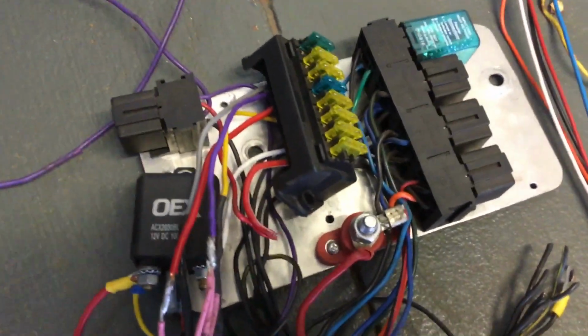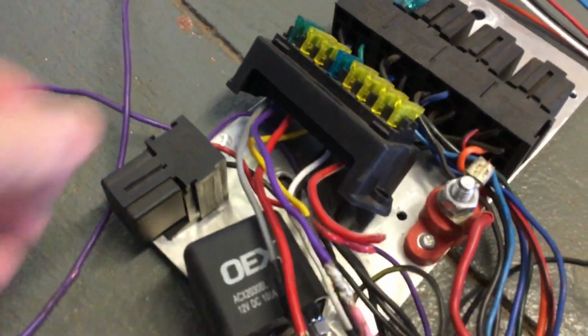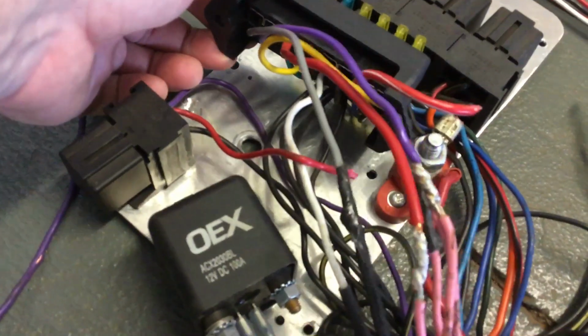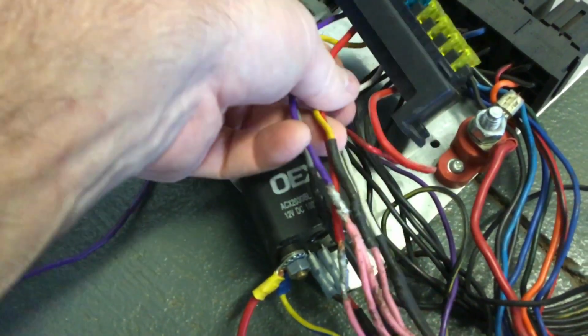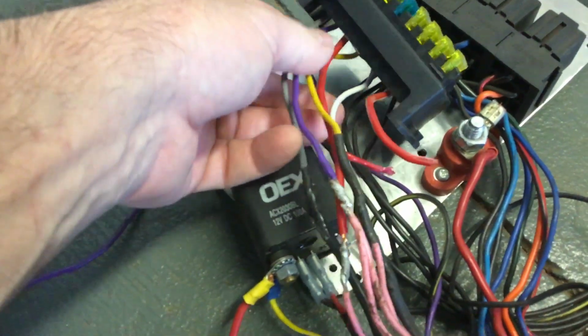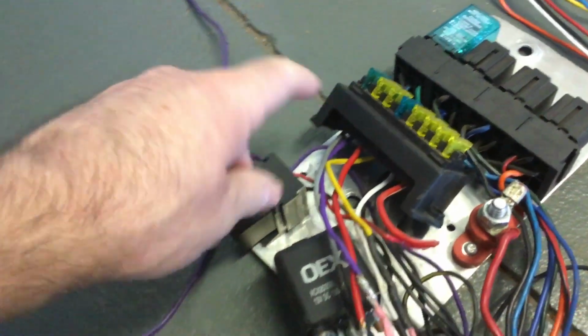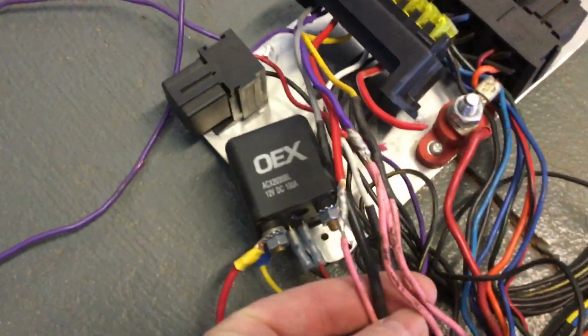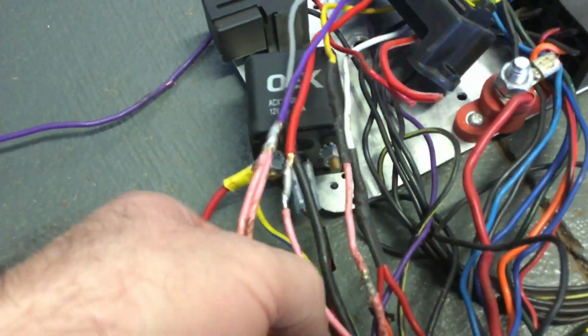But it took me a while to work all this out, because I was looking up Google and looking up fuse blocks one night after I started pulling all this out, and what I realised was that this is a generic, quite cheap item. So that fuse block comes like that with these wires, majority of those wires sticking out. So instead of either pulling a wire out and starting from here, they just get soldered. So there's your first big mistake. So once they get soldered, they branch off everywhere. So why you would do this is really beyond me, not after the money I paid.